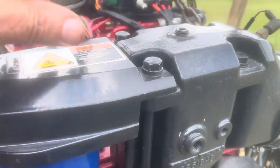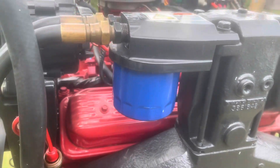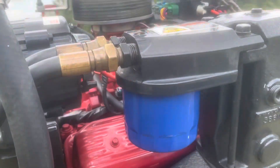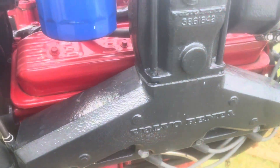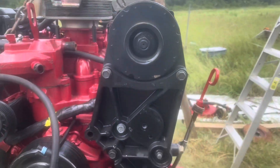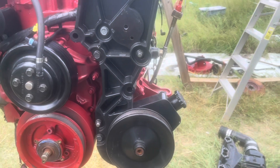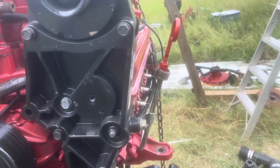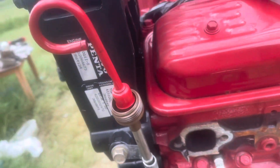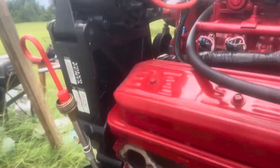I'm going to take off these two bolts here. I'm going to keep the oil filter system intact so it doesn't spill oil everywhere — I'm going to take it off as an assembly, or actually just take it loose and let it hang down while I'm taking this exhaust off. I just removed the belt tensioner and that left all these bolts exposed, so I can get this combination power steering and alternator bracket off the port side of the engine. First I've got to loosen this bolt for the dipstick, then take the wires off the back of the alternator, and then the whole bracket will come off as an assembly.